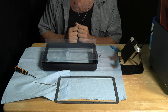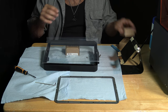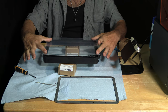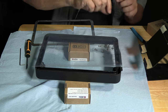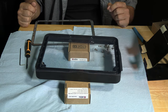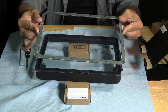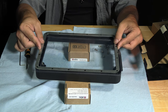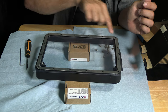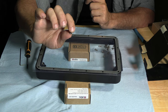You will also notice there are no pre-cut holes, not even notches for the large screws. I am going to take little cardboard boxes and rest my vat on those boxes so that the screws retract and are no longer in the way of my release material. With the screws out of the way, go ahead and peel off the second layer of protective film. Make sure that your overlap is roughly even on all sides of the print bed. Now we will take our metal plate and very carefully place it on top of the new resin release film, match it up with its slot, and examine your film to make sure it's sticking out evenly on all sides.